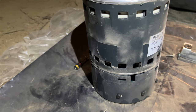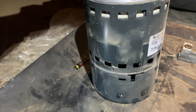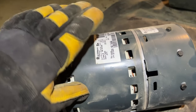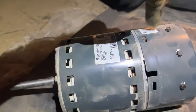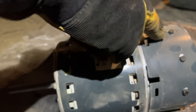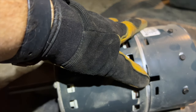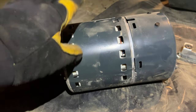Let's test this motor and see if it's the motor or the module — I have both and I'm going to change both. Basically you have two parts: here is the motor, which is a three-phase DC motor, and then you have your module, which is the computer and the inverter. In my experience it's usually the module, but I've changed just the module and then the motor goes bad and takes out the new part. I recommend changing both every time just to save yourself a callback.